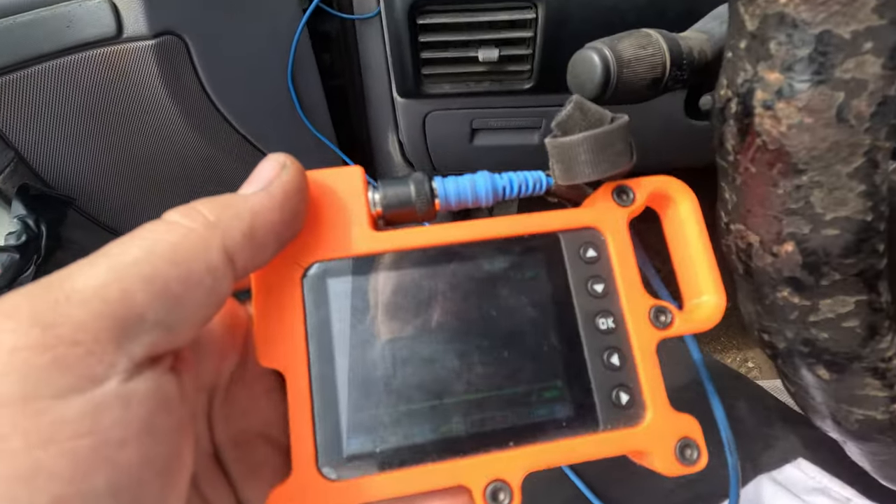I don't know if it was just a bad connection. We have a good signal — I'm assuming the pins must have been spread on that connector. You can see here we have a perfect square wave. Usually when it's going bad you'll see rounded corners, but this really looks perfect.